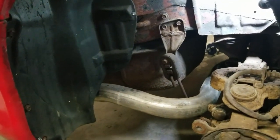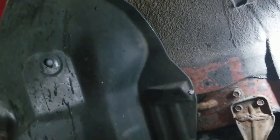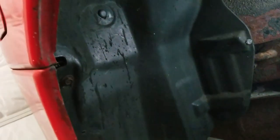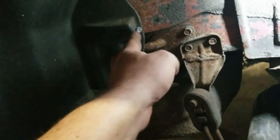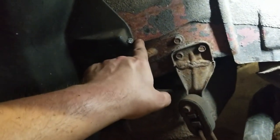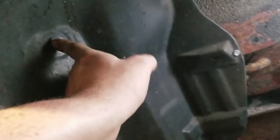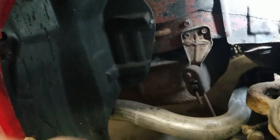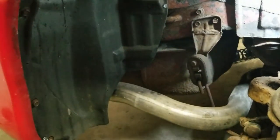Thanks to my good buddy Mark from Mark vs Machine on YouTube — I'll put a link in the description. He sent me these plastic pieces which I so desperately needed for my car, especially for this side. Unfortunately this part was supposed to have a plastic plug pushed in, but the piece was missing, so I just took a sheet metal screw and drilled a hole in the metal part of the car and it's in there pretty tight. I put one more right down there, and there's a push-in clip right here that had a hole for it. Got that in there nice and strong. I got new plastic for the other side too — when I work on that side I'll definitely show you that.